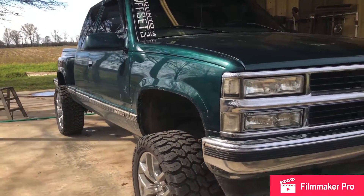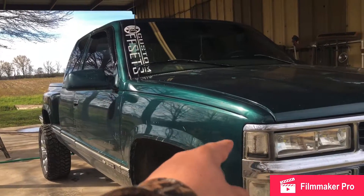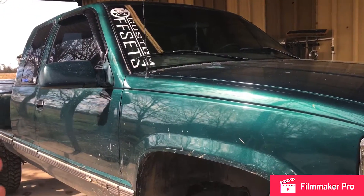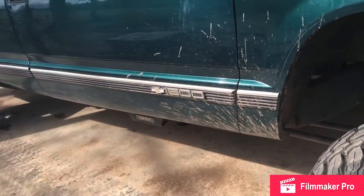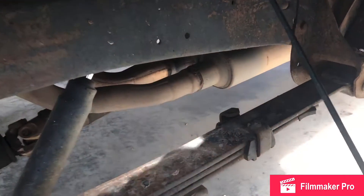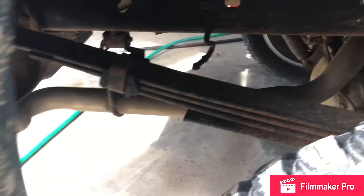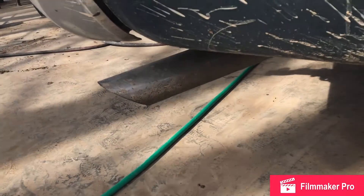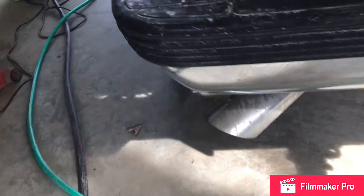I am running two duals — dual in, dual out — Flowmaster Super 44. My truck does have the 5.7 Vortec, and mine is a manual, so you will see some pauses in the exhaust notes, probably a little bit longer than your normal automatic shift. The muffler is right here — there is the Super 44. It runs over the axle and comes out at 45s. It's a 2.5 inch inlet, 3.5 inch outlet, 12 inch long tip. I was supposed to get 4s, but the exhaust shop only put on 3.5.